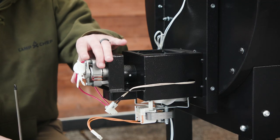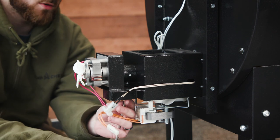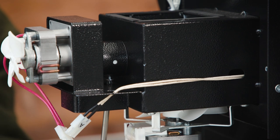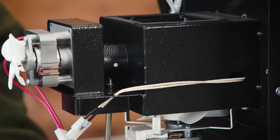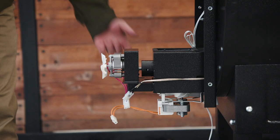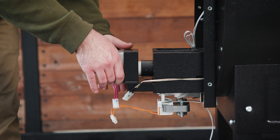To remove this entire assembly all in one piece, you just have to undo the screw by going up through it. Pro tip: if you have a magnet tip screwdriver or a long magnet, that'll make this step easier for you. Once you undo the screw from the bushing, you can now take the entire auger assembly out.